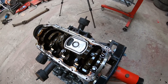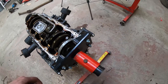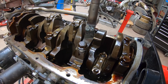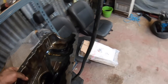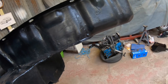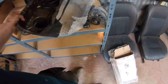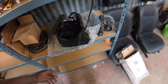For anybody interested in the CVH setup: this is the CVH pickup pipe that has been modified to fit. I didn't do it — I bought it like this. It has a welded-on bracket that sits on the main bearing cap. The sump itself has been modified — it's been cut out to clear the crossmember and a bit of an addition has been added on to the side of it, like a wing. So if you're looking to go the CVH sump route, that is the way it's done.